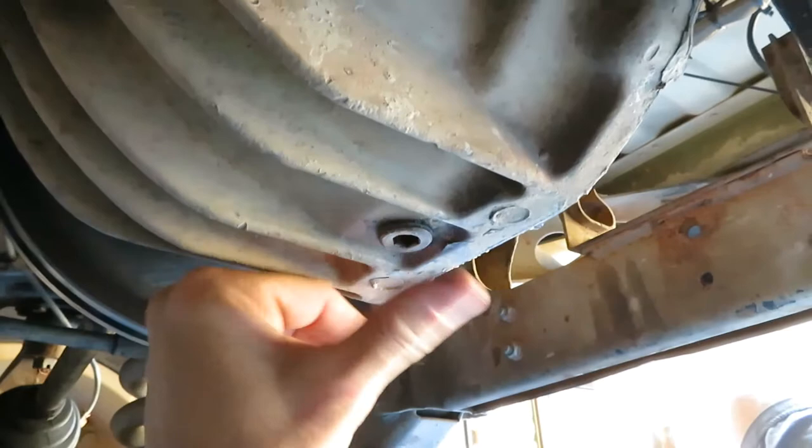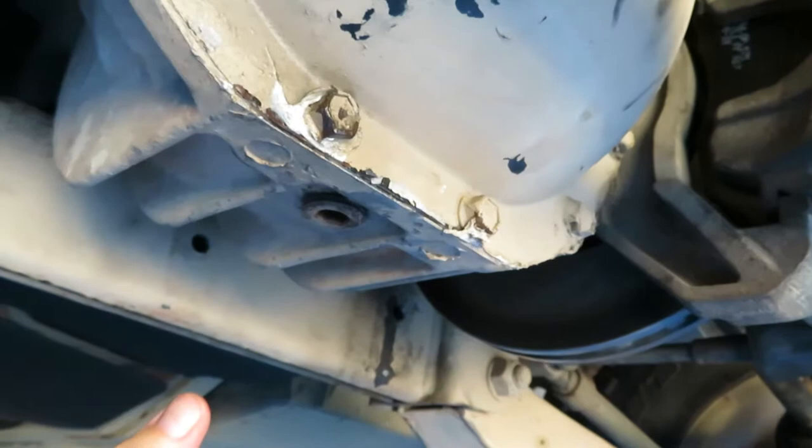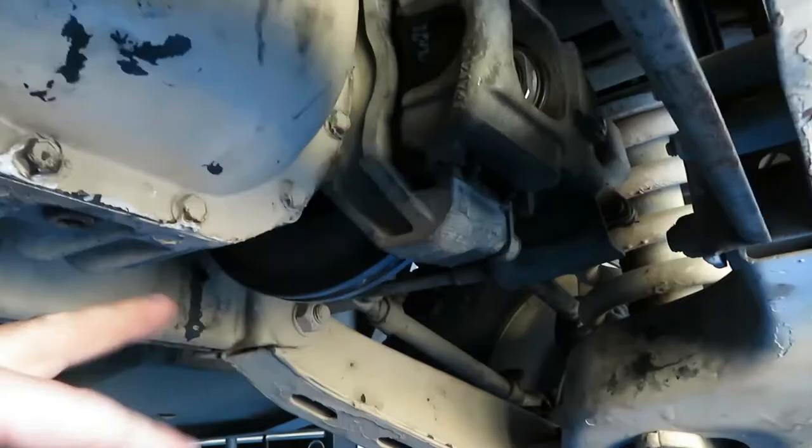As far as the differential, I thought it was making noises — it wasn't. I drained all the fluid from this plug right here. It takes about a liter and a half of 80/90 weight. I use Lucas Oil 90 weight — more than sufficient. This is the fill plug right here. I filled it in through this way and once it started to overflow I put a bucket underneath. Once it stopped dripping I cleaned it off and put the plug back in.